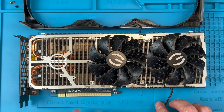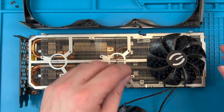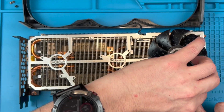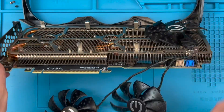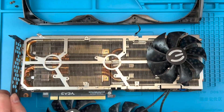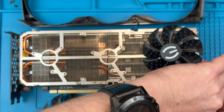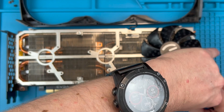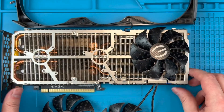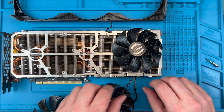The wires are held in place in the cable guide and you just need to unthread them down to the header sockets where they plug into the PCB. The fan furthest from the display port can be a bit tricky as it's routed through a hole in the heatsink and it's hard to get a good grip on it. Push the tab on the header plug and then give it a pull from the top to pull it directly up and out from the heatsink. It's a little fiddly but take your time and don't use excessive force.